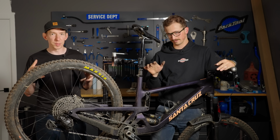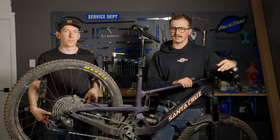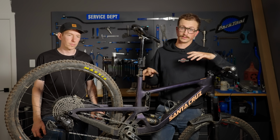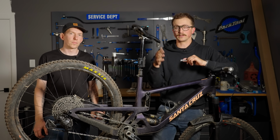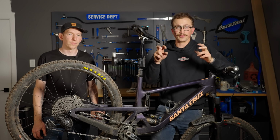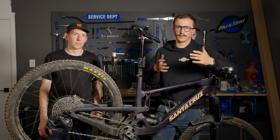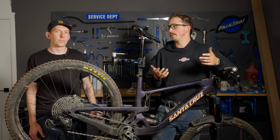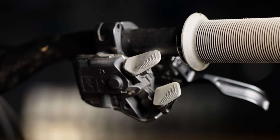We're in our special, very scientific laboratory shift speed calculation. I think it was pretty clear Shimano is definitely faster. Worth noting, Shimano has five different speed modes you can set the derailleur to in the app, and those speed modes dictate how quickly the derailleur moves up the cassette when you hold the lever down. That was in very fast, but even in very slow, it's still faster than Transmission. The neutral mode that it comes in is a healthy middle between the two, and I think it's where most people will run it. But most importantly, when you're just clicking the shifter, it's still moving up the cassette faster.